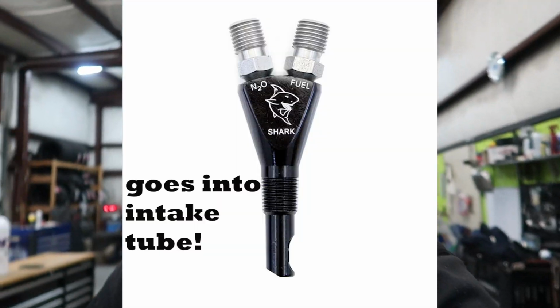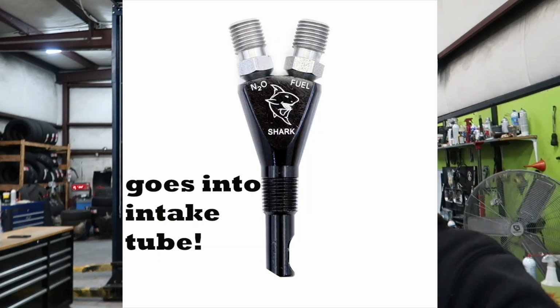Now if you're asking the question, what is the difference between a shark nozzle and a plate system? Well, a shark nozzle system works just fine. They do what needs to be done and they get the job done. But I will say a plate system is better. Now the only reason I say that is because it's got the spray bar technology and stuff in there. And whenever you have a plate system compared to a shark nozzle system, the nitrous hit is a lot stronger with a plate system. And I'll throw up a little clip here of a Nitrous Express demo with a plate system and I'll show you what I mean.